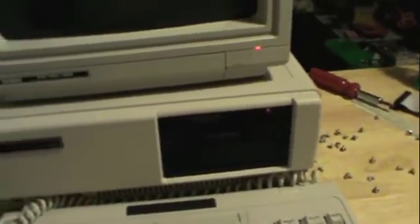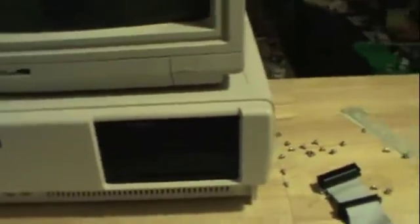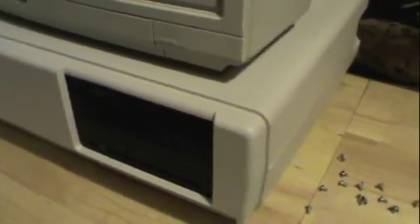Now I've got to figure out where I went wrong with this floppy drive. It looks like my cable might be reversed. After a quick Google search I was able to find the service manual for the Tandy 1000 series. I also found out why I can't run the high density drive on this controller card — because it doesn't support it. So I took the controller card from the other machine and stuffed it in, which supports high density drives. I couldn't figure out how to disable the onboard controller, so I may have to set a different IRQ, done by jumper settings on the card.